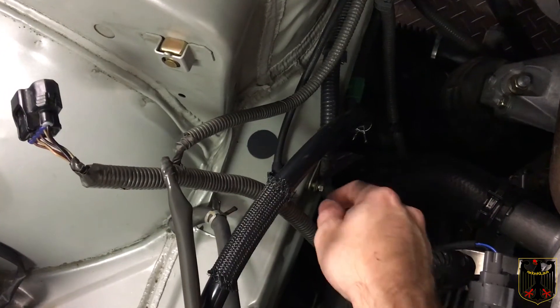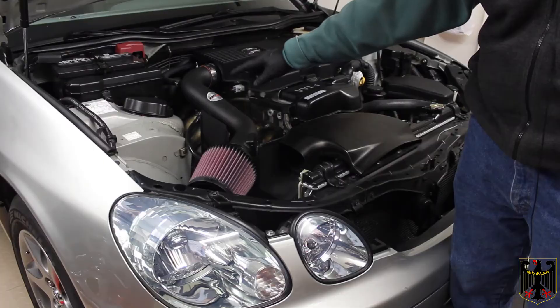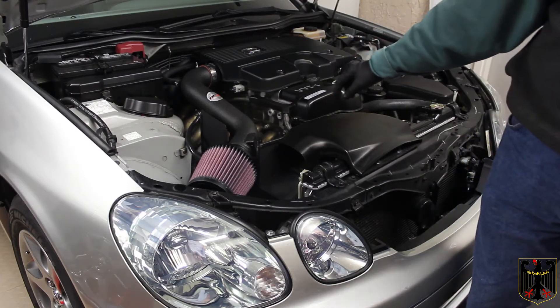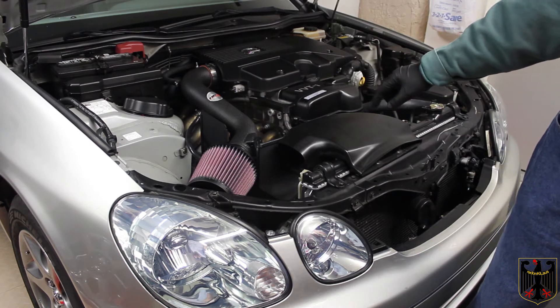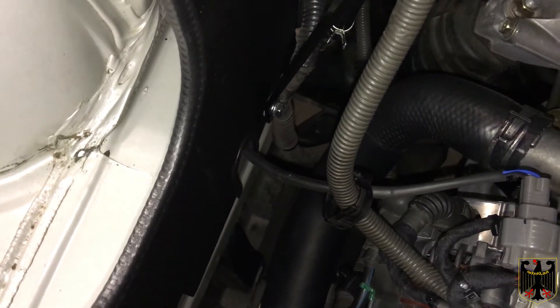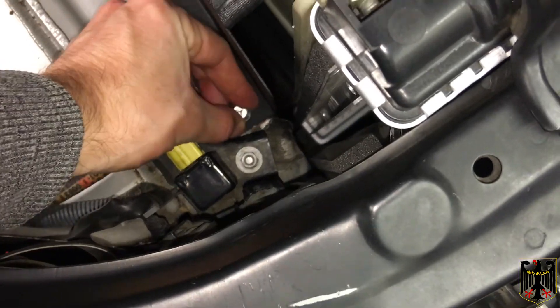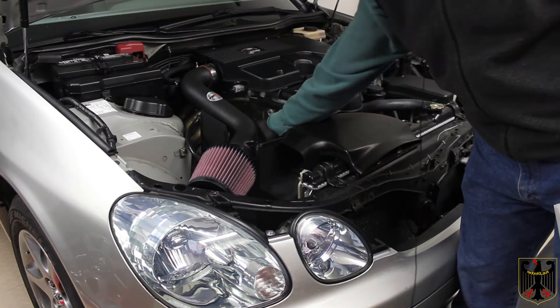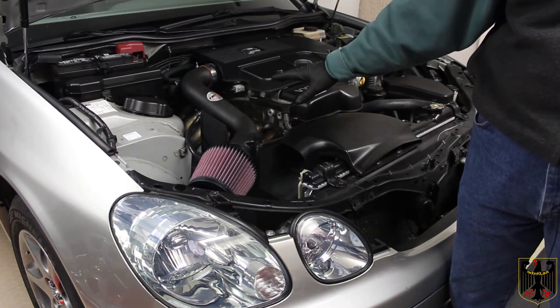You have to carefully remove a bolt located on the frame rail where the ground goes — we took that bolt loose and removed the ground. Next we slid this heat shield in. There's a bolt that goes in the front up here that's been tightened down, and another bolt in the back that goes in loosely so you can adjust everything to fit properly.